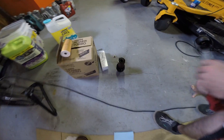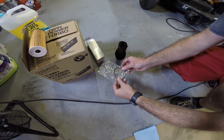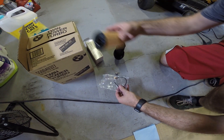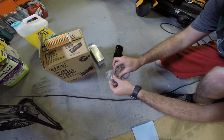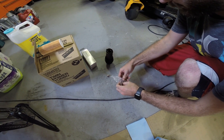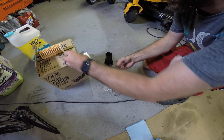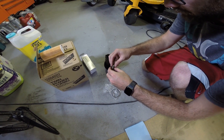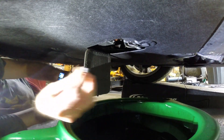Here are the seals in your kit, and then the new filter, which already has the seal on it. First off, we'll open this up and replace our copper o-ring on the drain plug — fairly simple, pop the old one out and in with the new. Then we'll climb back underneath and tighten this back up; it's down to a slow dribble.